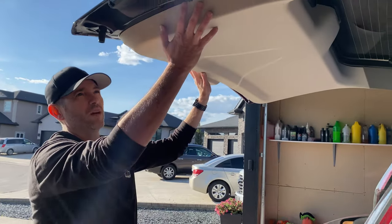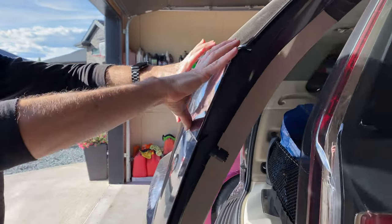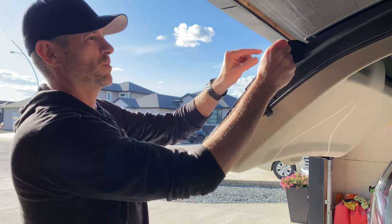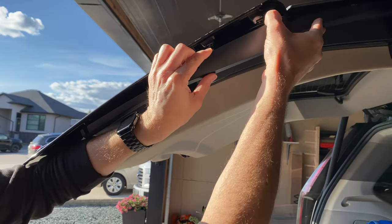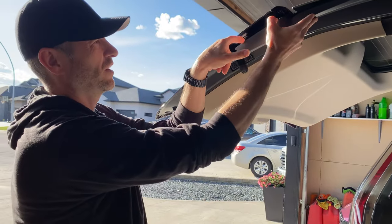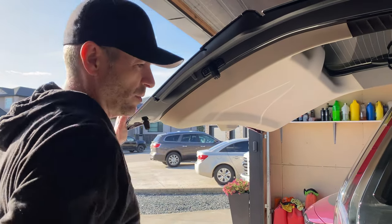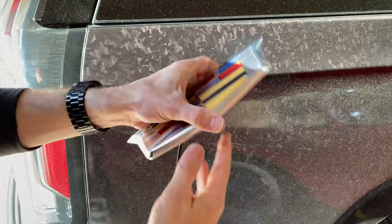Once you get this inner panel off, that'll start to expose all of the screws that hold this panel on. This whole panel, including the top black trim piece, comes off together. There are little holes in the sheet metal that allow you to push out plastic tabs holding some of this panel. From the side you can see a couple of bolts — two on this side, two on that side. Once you get this piece off, you can gain access to the bolts on the back of the emblem, unbolt it, replace the plug wire, and it's ready to go.